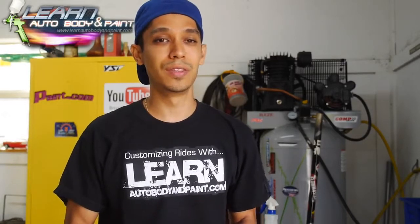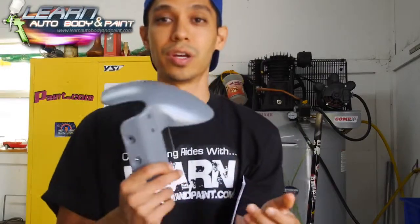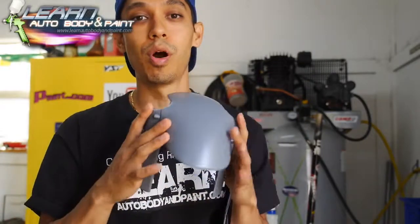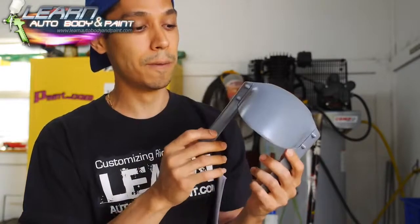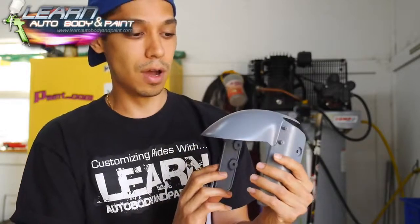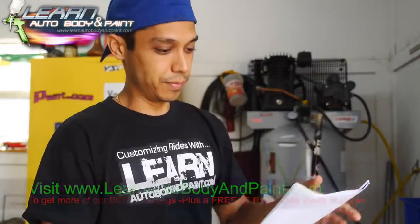The only reason for biting on a surface like that — primer not sticking — is an unclean surface. Make sure your surface is really clean. Here's a part of a motorcycle I recently primed up with 2K primer. Wash your part down before you prime it, take off all the grease, sand it down with 400 grit, then lay some heavy coats of primer. This is ready to be sanded down with 400 again, then base coat and clear coat. Use a good 2K primer and you shouldn't have any problems — it's just a contaminated surface.